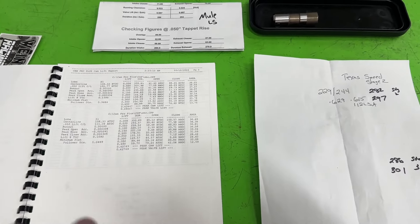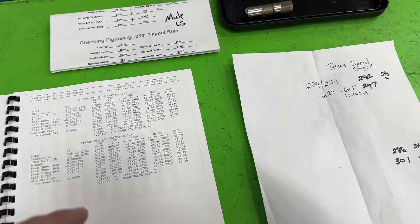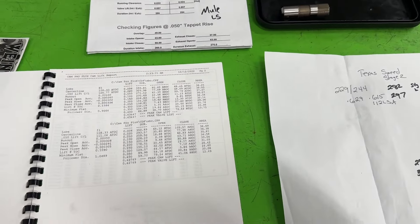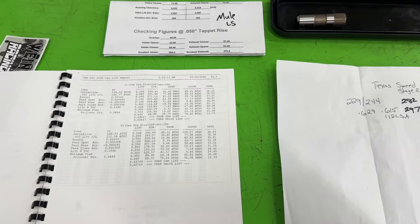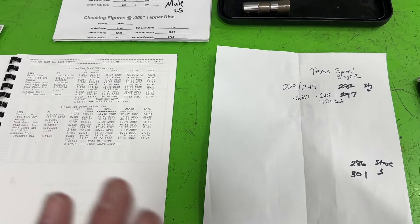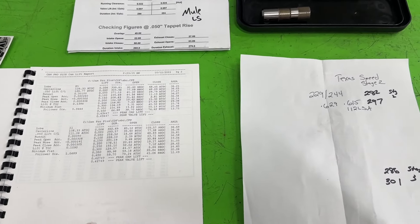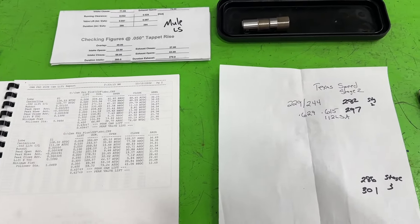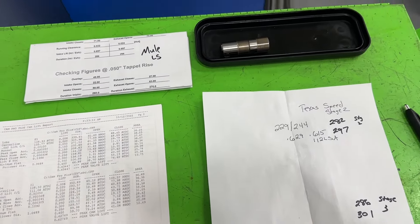There's a lot that can happen between when the valve opens and when the valve closes — in other words, how fast it opens and how quickly it closes. That's called the lobe profile, and it can vary between different manufacturers. They've got several hundred lobe designs where some can open really fast and some can open really slow. But for this particular video, I'm only dealing with the moment that the valve actually opens — the durations are fairly close.